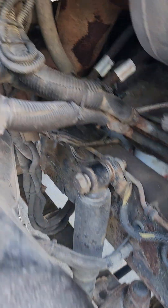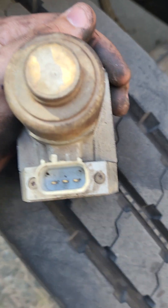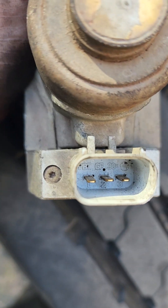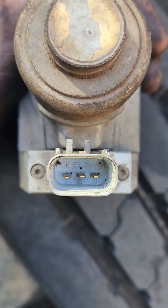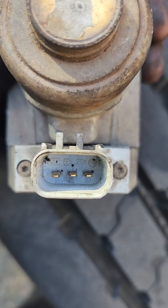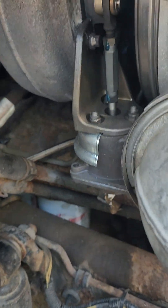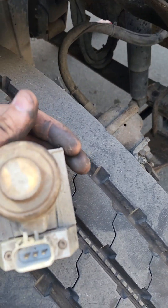This is the old one. There's a three-pin plug that goes into it. If you hold it like this, the one on the very left is your 12 volts, the one on the far right is ground, and the one in the middle is controlled by the ECM, which is activated by your PWM 4 circuit. When the ECM sends the signal for how much air to let through, that opens your waste gate valve — the actuator — and it functions according to whatever the ECM is telling it.